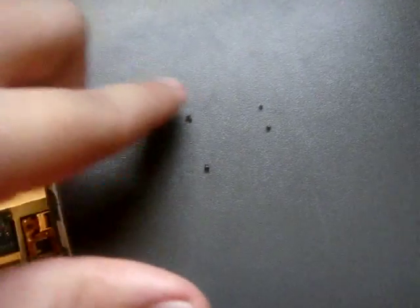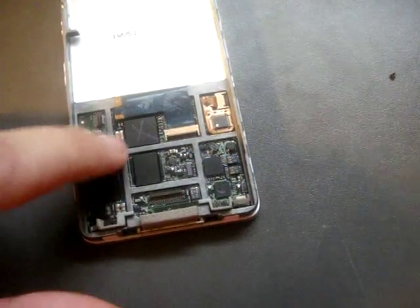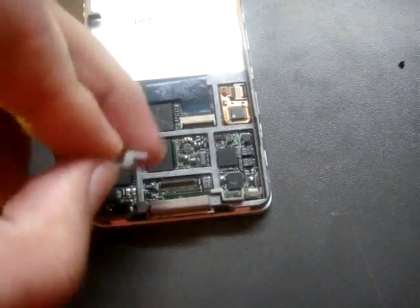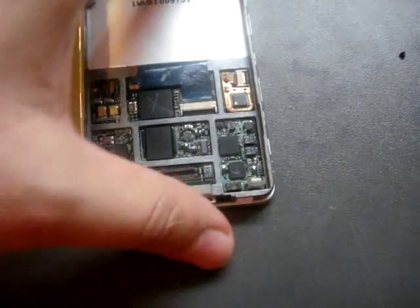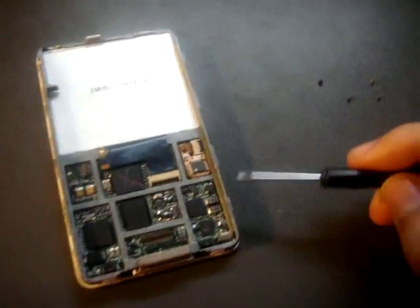I'll be back after I take off the screws. Okay, I've unscrewed them. You can see they only had four screws, but with an original one — one that's really not been messed with — it'll have six. Now what you have is just this: this is the motherboard, this is the metal bezel. You can see the screen connector and the click wheel. You take these little rubber things off — I think they're resistors, I'm not really sure what they're for, but they seem to be important. So now that the screws are off, you'll take something flat — probably the flat screwdriver — insert it. I need to find a way to put this over, open. I'll just set it down and you'll watch me.